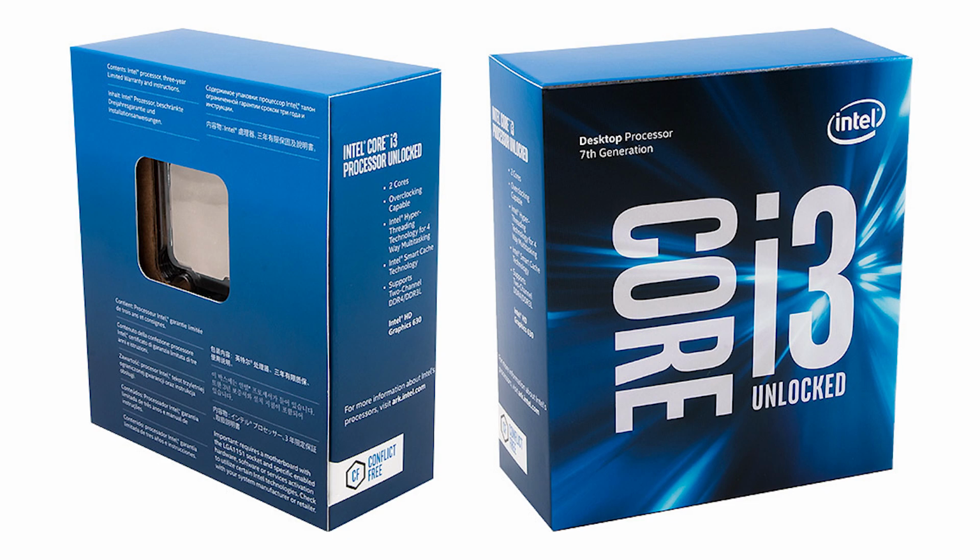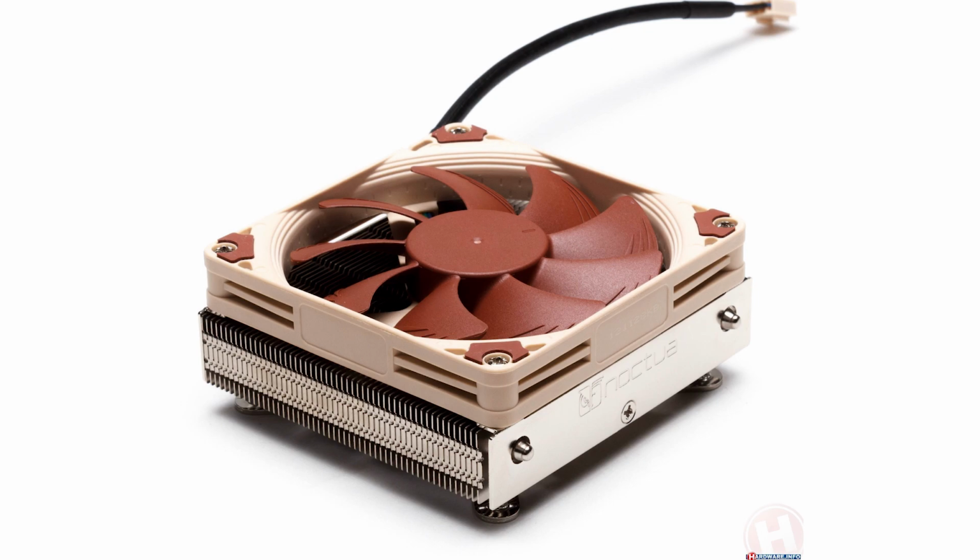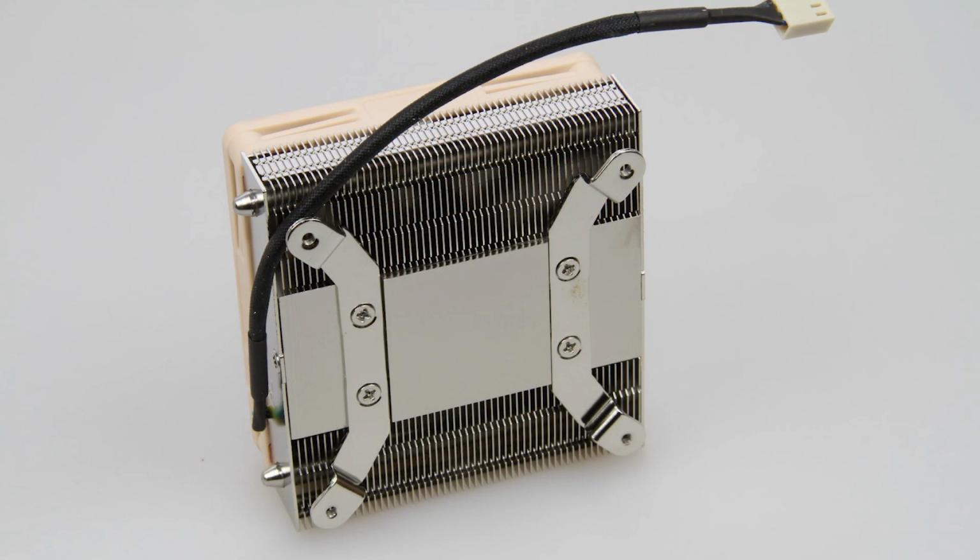And seeing as an Xbox is very thin, the cooler that I'm going to be putting on has to be very low profile and needs to be able to get some clean air, which is why I have gone with the NH-L9i from Noctua. This is a very good low-profile cooler that is very popular on mini ITX PCs. This cooler boasts 100% RAM compatibility and 100% graphics card compatibility. And in the footage that you will see soon, you can really see how thin this cooler really is. It is only 37mm high or 3.7 centimeters, which will make it ideal for my Xbox build.